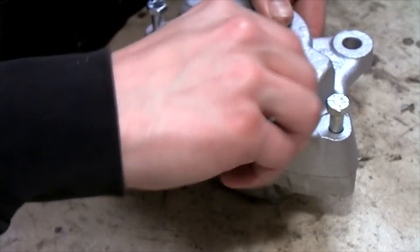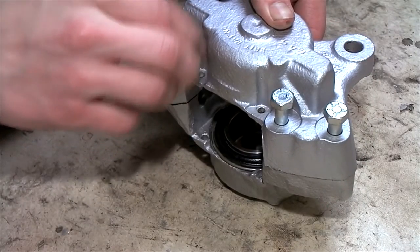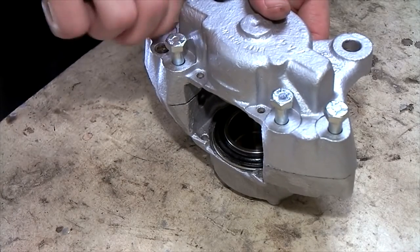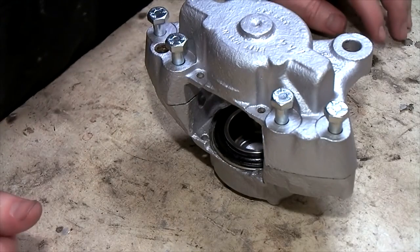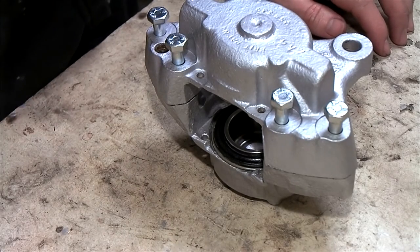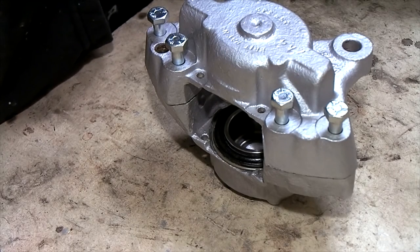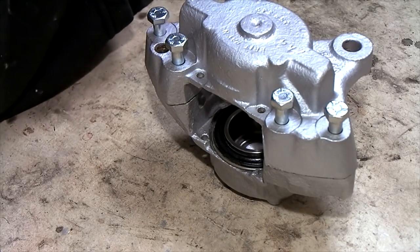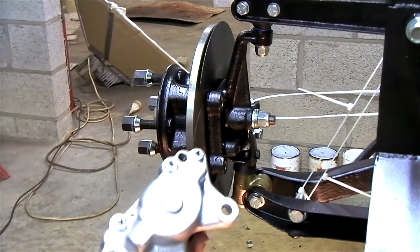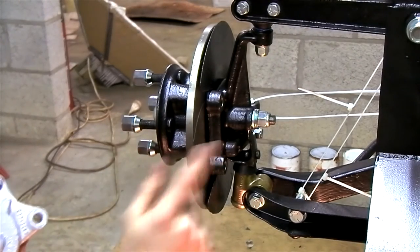I greased all of the mating surfaces and put the bolts on. I am going to torque them to something between 15 and 19 foot-pounds and hopefully this won't break the bolts. I have torqued all the bolts to 17 foot-pounds and hopefully that will be enough. Now it is time to mount the caliper bracket — you need to use these special bolts that have a really long shoulder, and I got these from Europa Engineering.